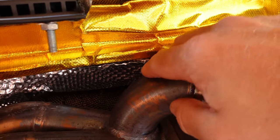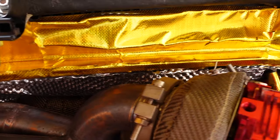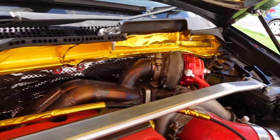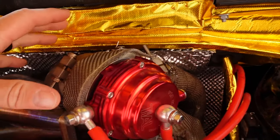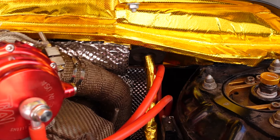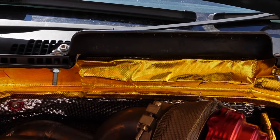You can see it sits quite close to the wastegate area. That's the metal bulkhead behind there, and I've got a metal heat shield in the way to keep the bulkhead a bit cooler. And because everybody apparently hates gold reflective tape, I've stuck it everywhere just to be really annoying. The theory is that it's going to help get rid of some of the heat that builds up in there. I've also left off the bonnet rubber seal to give a tiny gap all along just to help it out.